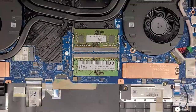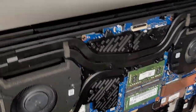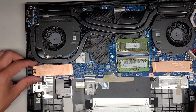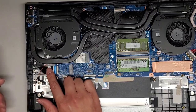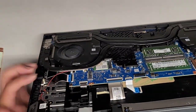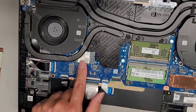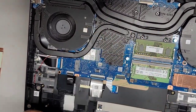You've got two slots here for M.2 SSDs — I'm pretty sure they're both M.2 PCIe NVMe compatible. There's no SSD in this slot — the SSD is actually over here. We're using a JIS1 screwdriver to remove internal components. After removing that screw, you can pull this back. They actually put a thermal pad here even though there's no SSD. There's a speaker connection here and the fan connection. This cable is probably for the two USB ports. The wireless card is here underneath the heatsink — if you need to remove the wireless card or antennas, you have to undo the whole heatsink.